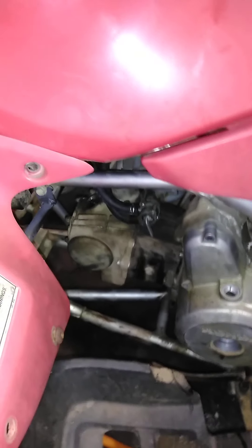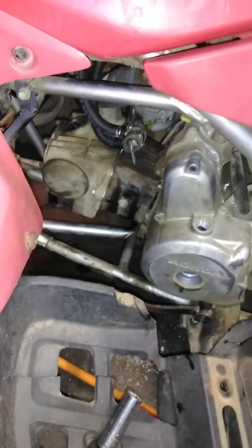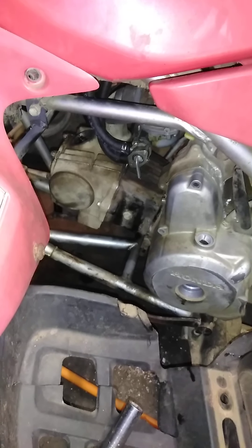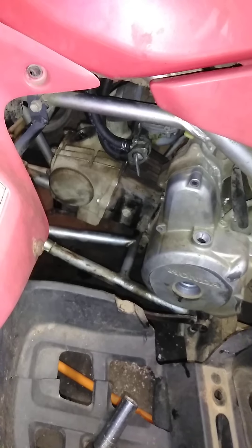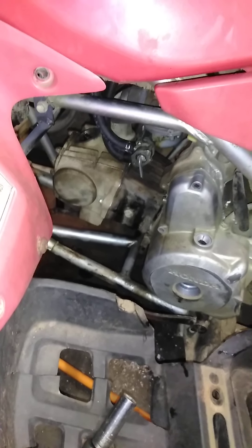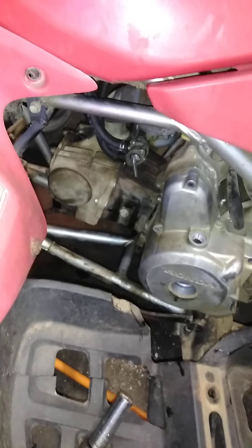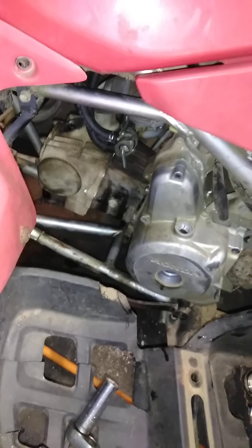So we're going to tear the head off and see what's going on — maybe the valve is bent or just has a lot of crud around the lip. But anyway, that's an easy way to check your exhaust and intake for leaks. Don't use much pressure — more than a pound or two will just push your piston and you won't be able to diagnose it. Like, subscribe, and hit the notification button.